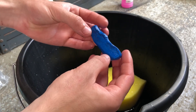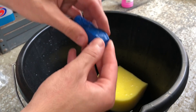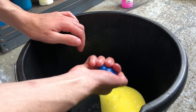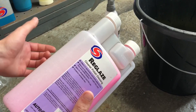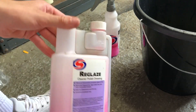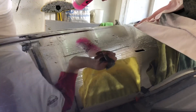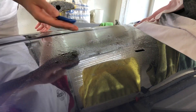I've chopped off about a quarter of the clay bar and I'm just going to put it in some warm water now to make it more flexible. After about a minute or so you can then make it into a little ball — it's softer to use and pretty much ready to use on the car. This is the stuff I'm going to be using alongside the clay bar; this is the Autosmart one but you can pick up any other make really. All it does is give you a bit of lubricant when using a clay bar on the car. I'm just going to spray it on — make sure you keep it wet all the time.